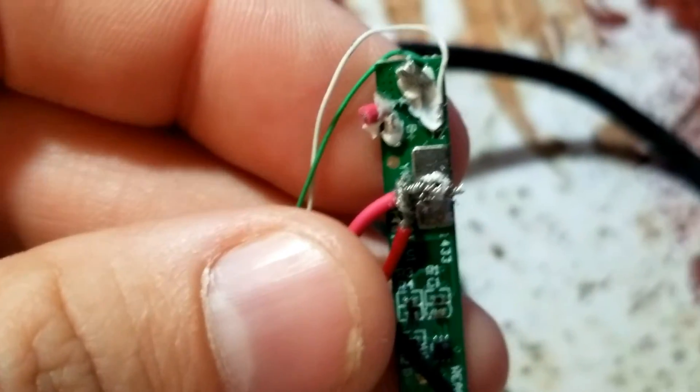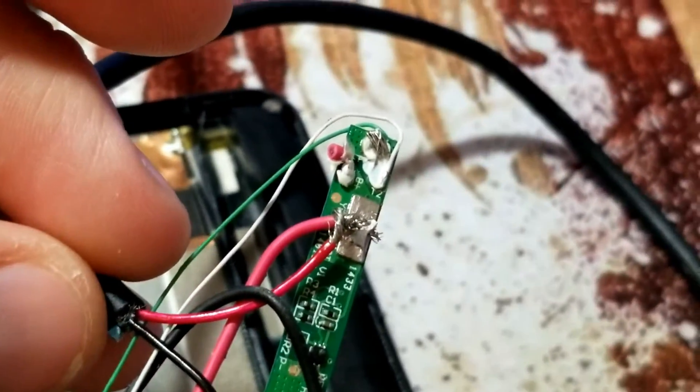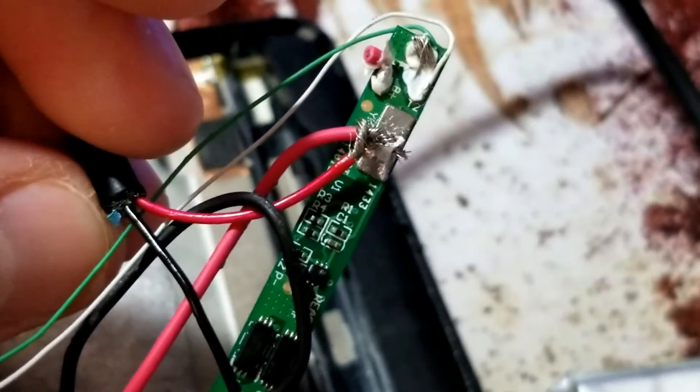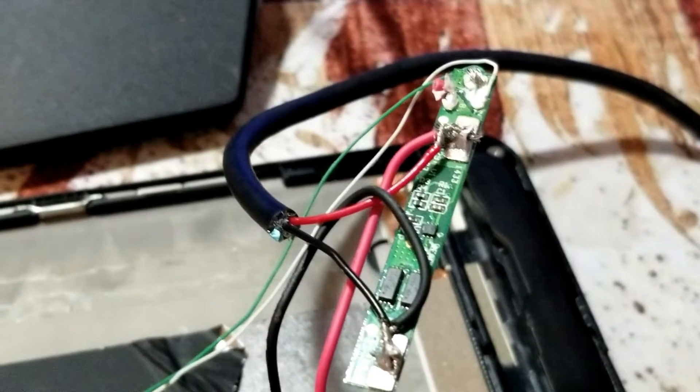That's the gist — I just wanted to show the feasibility of connecting your tablet directly to power. Sorry for the harsh lighting. Thank you for watching. Just to clarify the wiring: the two wires from the battery connector were wired directly into the board, and the charger was also wired into those same cables so the board and the tablet both get power. The green and white wires stay connected to the board throughout. Thanks for watching.